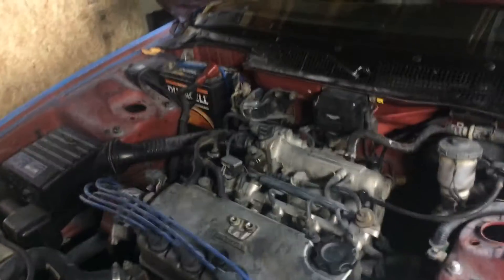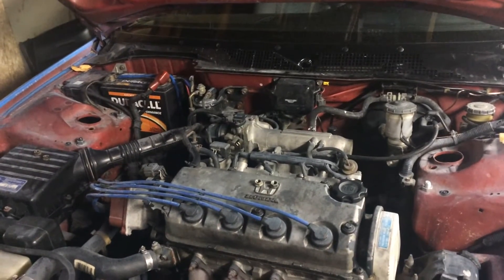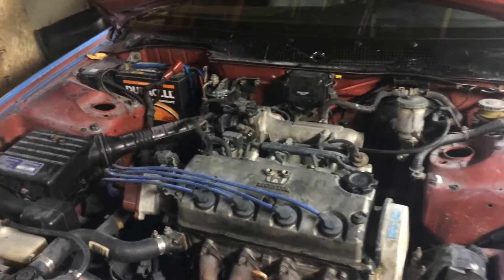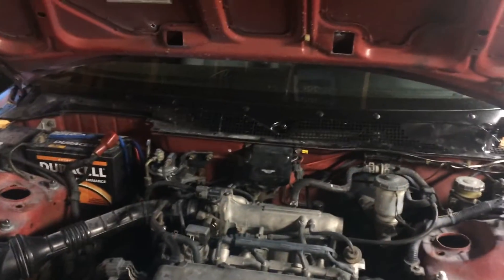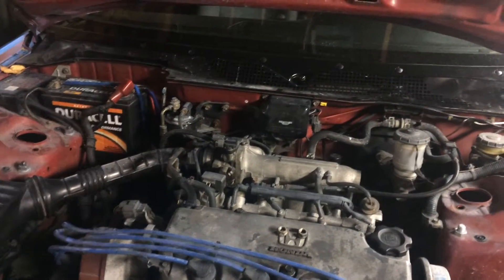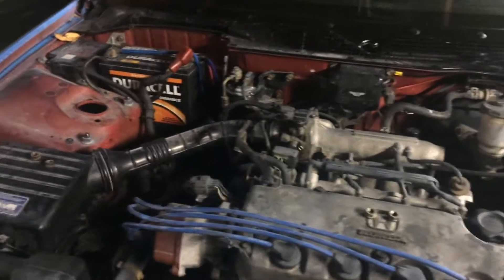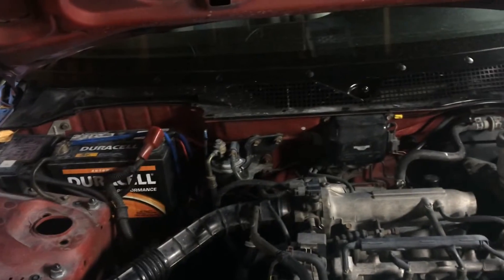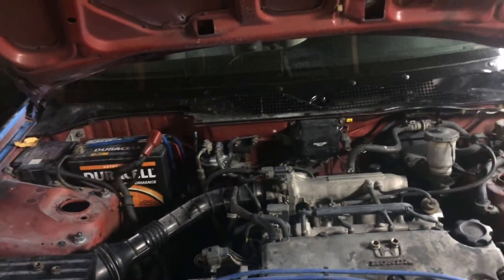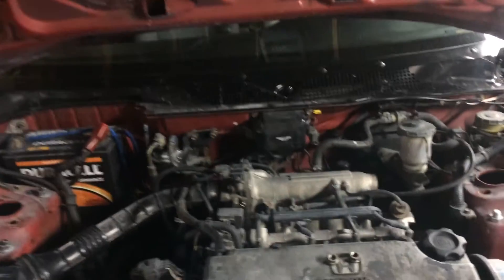But I don't actually have a vacuum leak. If it's just idling in the driveway, everything's fine. I back it out, take it on the road, and start driving. If you're just driving through the gears normally you don't notice it, but if you're coming to a hill and hypermiling — push the clutch in, put it in neutral — the idle bounces, fluctuates up and down. It goes up, falls on its face, up, falls on its face.